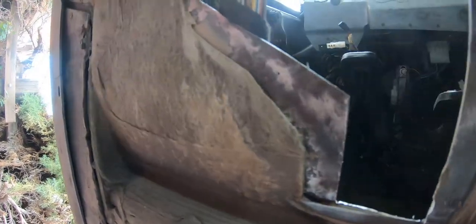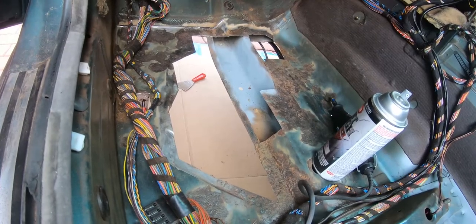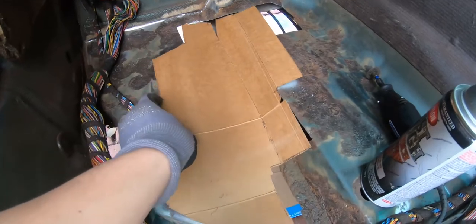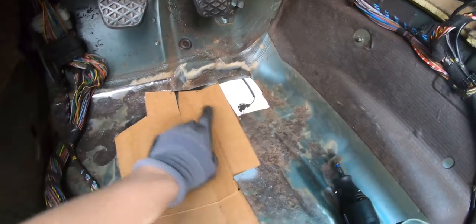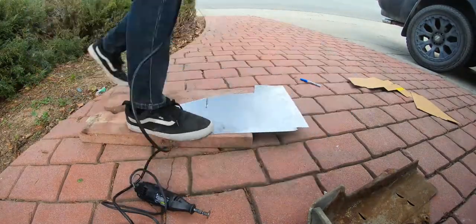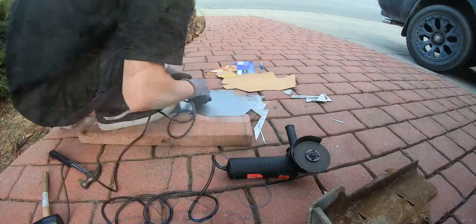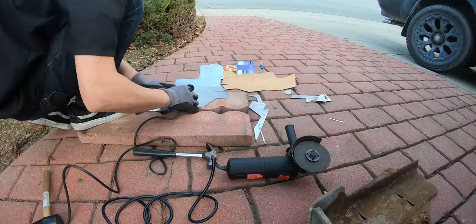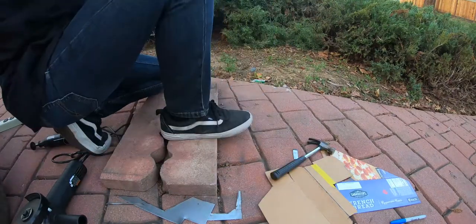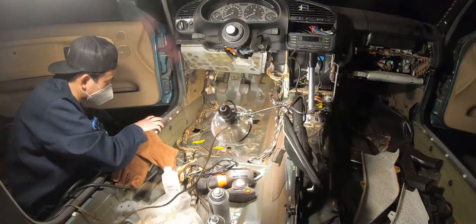We're under the car right now, and you can see right here I got rid of all the undercoating around the area that I'm gonna be welding. So now I can start preparing the sheet metal that I'm going to be replacing all this with. I already have a template for this big piece, but it doesn't cover up here because I cut this after. So I'm just gonna need to make this bigger, and then also cut a small square for this bottom area. So I'm gonna start welding now — try to tack it in place and then just start going around.